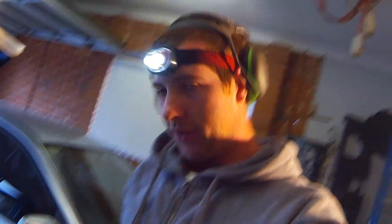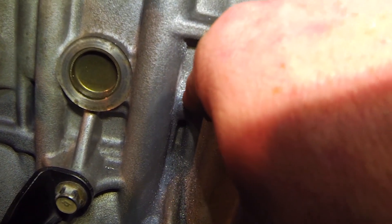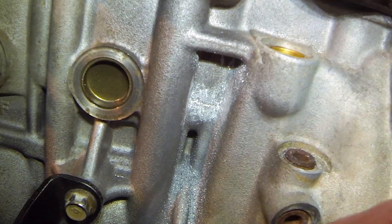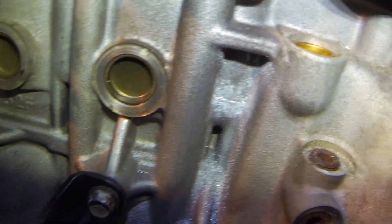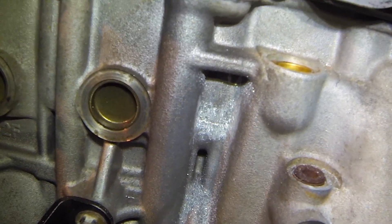About five minutes of Dremeling - here's what we got. We've veed out the initial crack which we saw with the soot from the blowtorch, and then we've kind of rounded out each end of the crack as much as we could. It's kind of hard to fit the Dremel in there. We've really roughed up about 10mm top and bottom around the crack and also around onto the side. Next up we'll chuck the JB Weld on and pray that it holds.